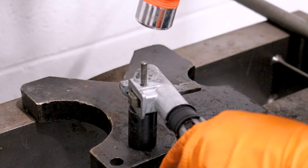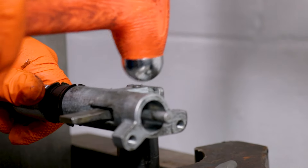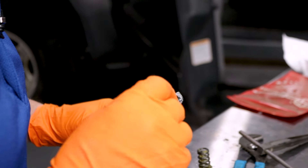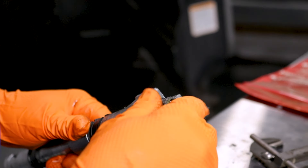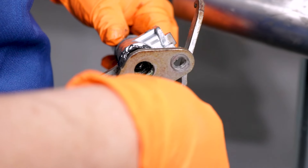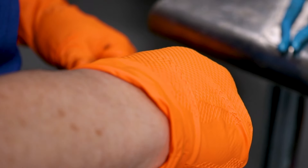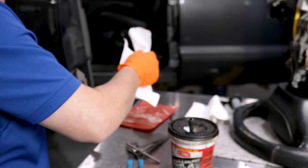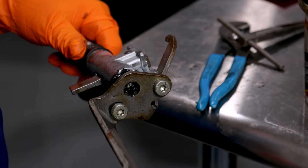That's the most important part — that piece right there. If you get confused, look at your old piece and you'll see where that knurl lined up. So now I'm just going to come back over and make sure it's level. I'm going to add some grease to where the spring goes. Slide that right in there, then get the bracket — you can see how it lines up. If you want to put a couple of drops of blue or green thread lock on that, I highly recommend it, because with aluminum the steel bolts will vibrate and slide right out of the aluminum casing.